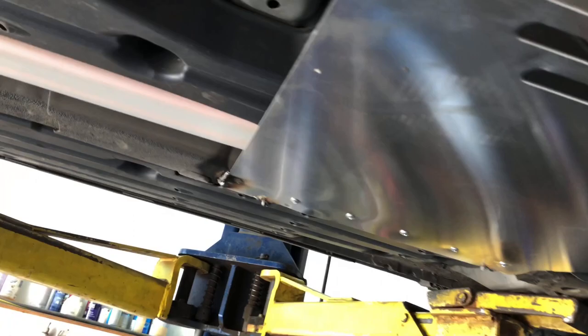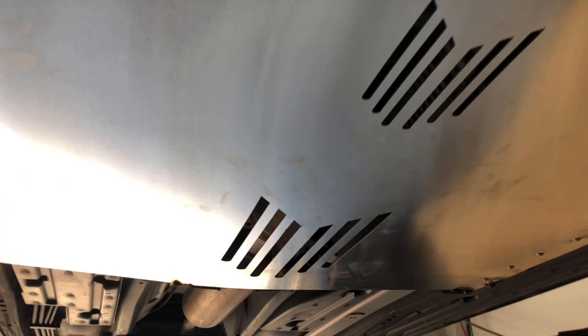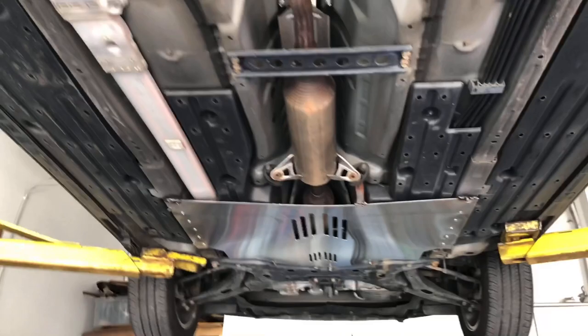I did some welding on the 10-millimeter bolts so it can still be opened with just a socket — you open it and you're done. This is the metal piece I told you about: it stops the rattling and keeps some distance between the catalytic converter and the shield. Hopefully this will help and give the customer peace of mind, so when they park their car they're not constantly thinking their catalytic converter is already stolen.